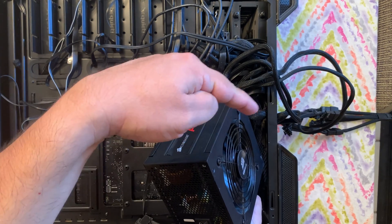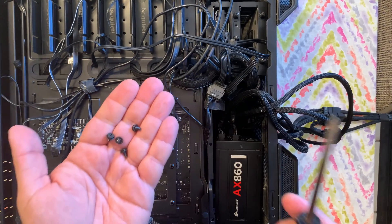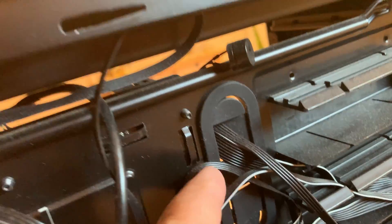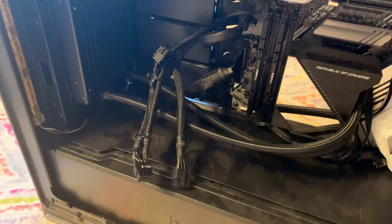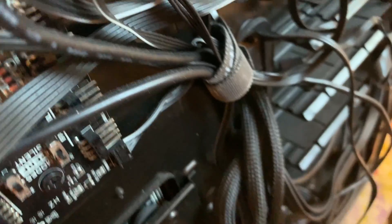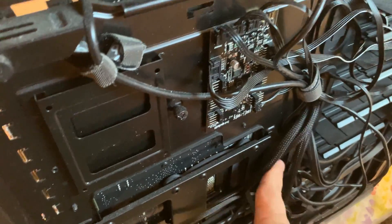Make sure this fan is facing down. I'll take the four screws and screw down the power supply to the case. The power supply is secured. It'll be easier to route the cables through these grommets. I'm going to try the second grommet rather than the top one. Starting with the thick cables — there's one through, now the second. Here's the other side so you can see — my GPU is going to go right where these three slots are. I do have an inverted case, so if it looks a little different, sorry about that. All four cables are inserted through the grommet. Hopefully the side panel will close with all these thick cables — might have to tie them down a bit.